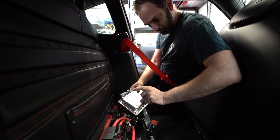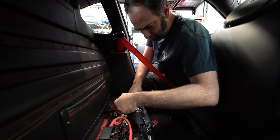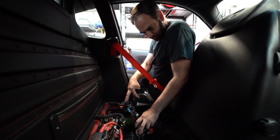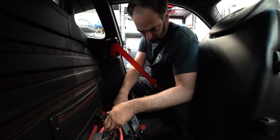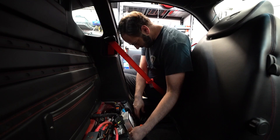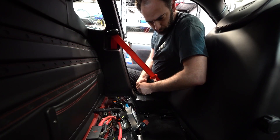Just the opposite of before. Remember: your computers are marked side to side — SX is left, DX is right. We didn't fully disconnect the brackets. Also make sure to note that the ECUs go in different positions on each side. This bracket has a big kickout, but behind it it does not. On the other side, the kickout goes the other way because it butts up with your transmission computer. Pay attention to that, otherwise you'll spend a lot more time and energy than you need to.